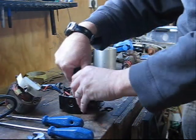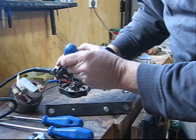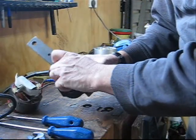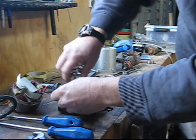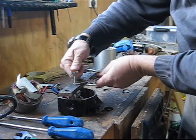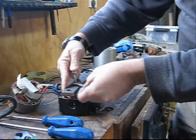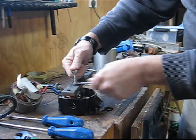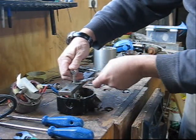I don't know if there's a proper device for removing this, but it's the one I've made. I'm going to hook it in below — fortunately there's quite a big gap in the back here — and sit it down like that to hook the bearing. I'll wind this up and start applying pressure to the bearing; it should lift it out. I just start gently winding, and as it goes I can see it's actually pulling the bearing out. I'll give it a 90-degree turn so I'm pulling the bearing up as squarely as I can.